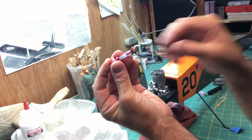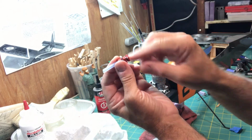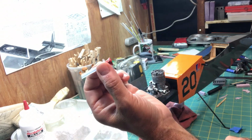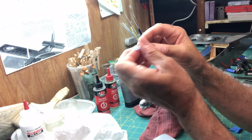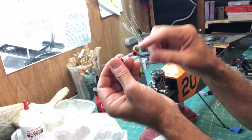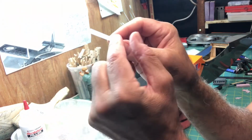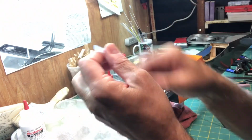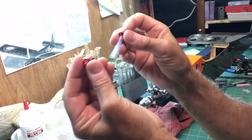And then you take it out, obviously, you refuel, then you put this back in. And when you push this in and then you screw it, it screws in like that. Now it doesn't seem like a big deal, but actually the 2 or 3 turns it takes to screw this in ends up twisting the fuel tubing inside, and you end up with sort of a curly Q. It looks like a pretzel in there. And so I don't think that's a really good idea.